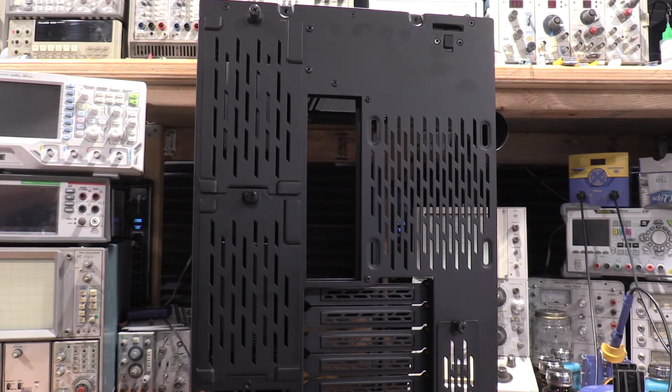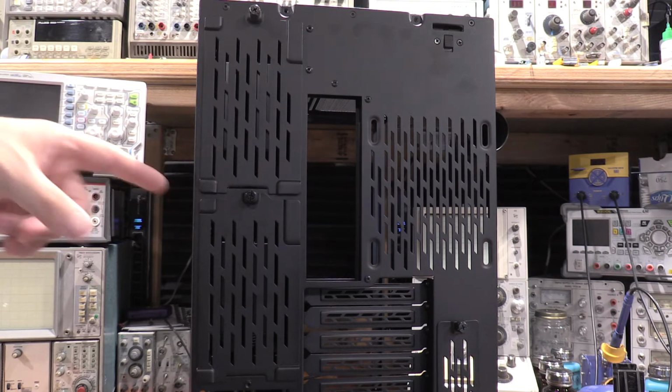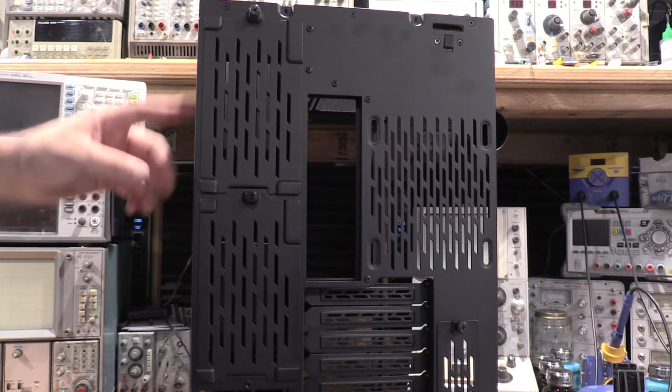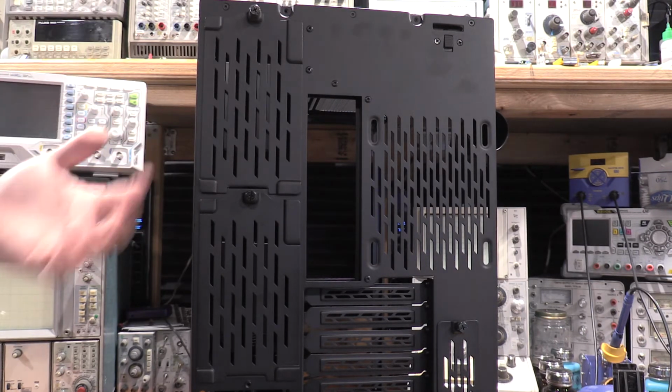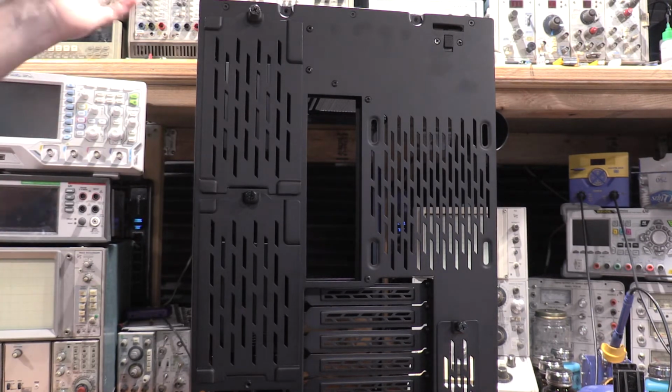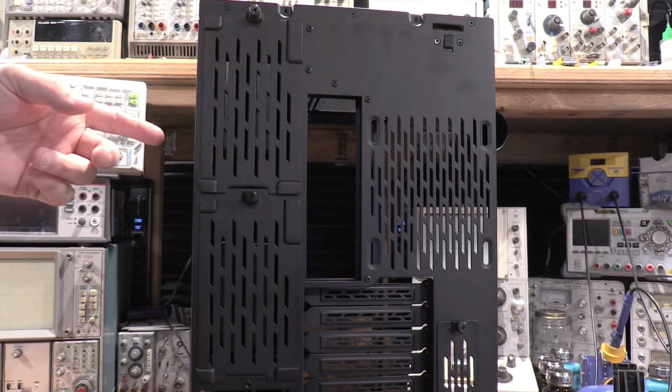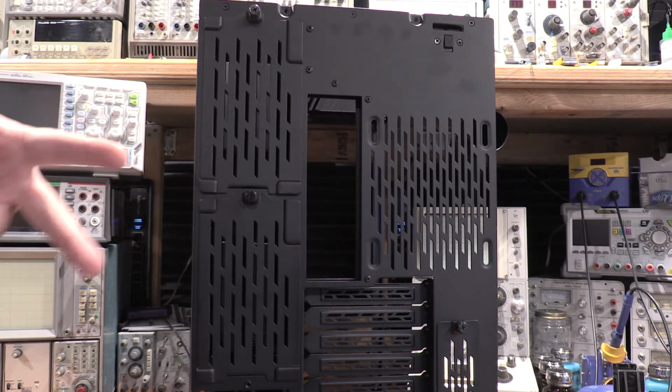I've already backed up all the data on the secondary hard drive in the other one. I pushed it up to my file server, so I don't need to worry about that. We can actually blow it away and recreate the RAID. I didn't want to take a chance with any kind of migration or upgrade, so I'm just going to wipe out the 2 drives that are in there. It's in RAID 1 right now, mirrored,